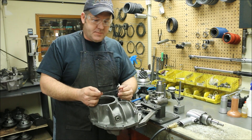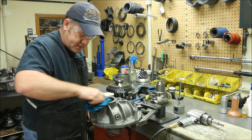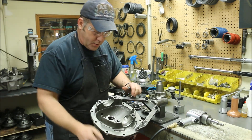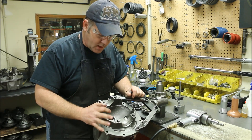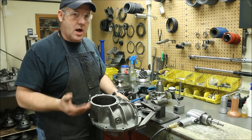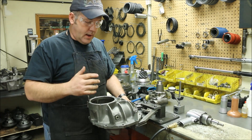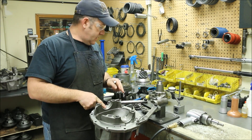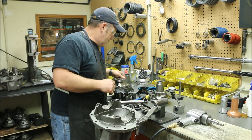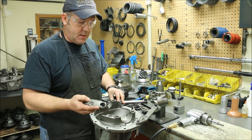You always want to keep the pinion depth shim with the original assembly. I'll go ahead and do another quick inspection. Some problem areas on the Ford 9-inch — on all the OE stuff. This is an aftermarket case, it's built up and really heavy. But on the OE cap applications, they tend to crack across here if they've had any kind of shock load. In the circle track world, which is what we do a lot of, they tend to hit each other, they tend to hit the wall, and that's what causes a lot of cracking. The gear side carrier cap on stock applications cracks quite a bit too. In the aftermarket world, the caps are not cast — they're forged steel. And that's one of the biggest improvements that anybody can make with an aftermarket case.